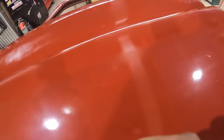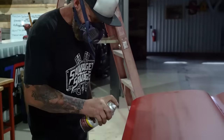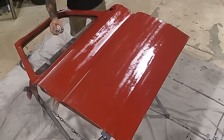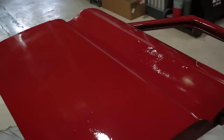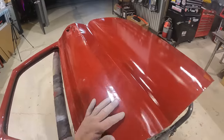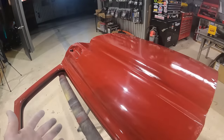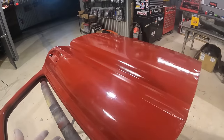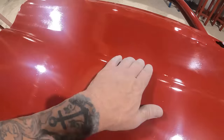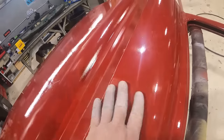I'm going to let this dry for about 30 minutes and then apply the top coat, which will be a colonial red, then we'll sand it and show you guys the patina. So now that my top coat is cured, we're ready to begin the process of weathering this door. Be creative — there's no right or wrong. However, you don't want to create patina that looks completely fake. Google patina, get some references — see what really gets worn. This edge right here would definitely take a beating from sun and rain, as well as this whole surface.